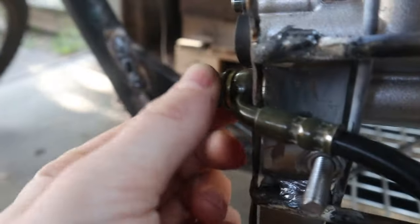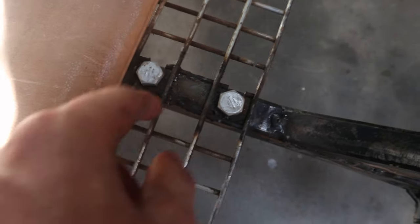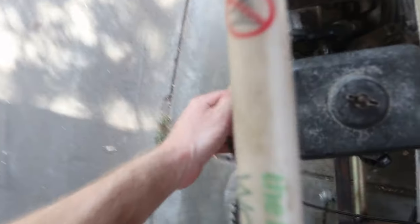Minimal movement needed, so I'll just tape it up with some padding — that'll be a nice hold. I need to bleed it a bit because there's quite a big air bubble in there; I had to rotate this side and it leaked a little — it says DOT 4 fluid. I mounted the seat with some small metal screws. The front of the trolley is mounted via a plate welded directly to the frame, with nuts welded on for the bolts — they've all just been tacked so I need to go back and tighten them since two have already broken. Set up the throttle too — gone through two sets of cable but the cable setup's not ideal; I need a longer piece.